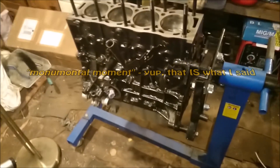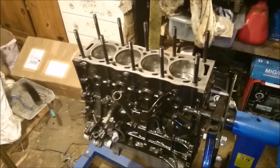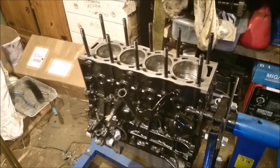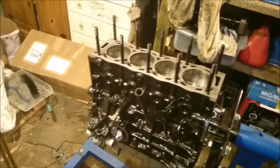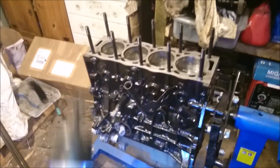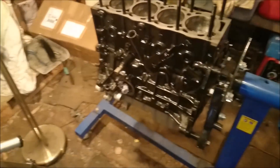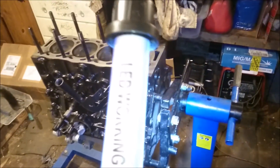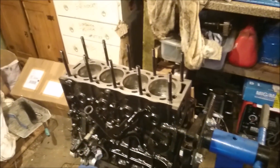I guess this is a bit of a monumental moment — I'm not going to rush this. The head has all the valves in, as you've just seen hopefully, and the block is ready to receive the head — studs are in place, the deck is ready, we have a gasket ready. ARP stud thread torque is 100 foot pounds — you're doing three stages, but that's the basics of things. I've put all the pistons halfway down the bore as protection. The cams don't need to go on yet because obviously I need to get a flywheel on to know where the crank is in relation to the head.